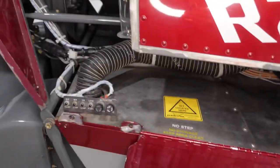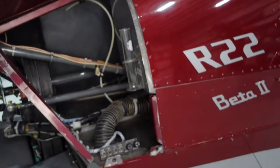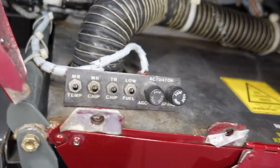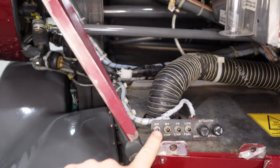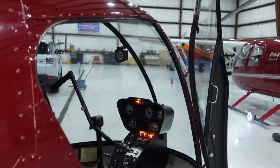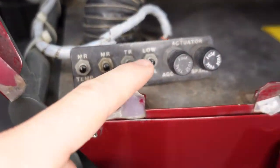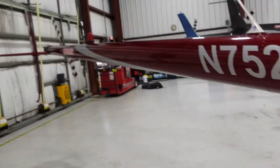The next place we're going is the aft cowling, on the right side of the helicopter. I'll fold that up and fold this down. Right back here we have our warning light test switches. On the top of the instrument panel we've got all our warning lights, so we're going to test to make sure they work. I'll press this — this one is main rotor temp light. I'll look in there and it works. Main rotor temp works, main rotor chip works, tail rotor chip works. And the last one is low fuel, which has a little bit of a delay — that's perfectly normal. That's all the electronics and lights I check.